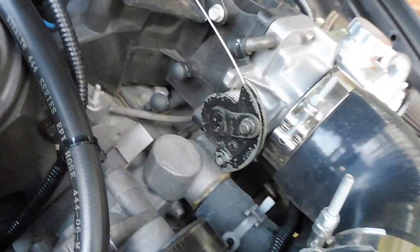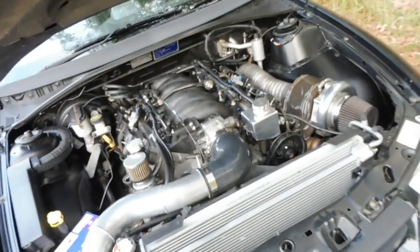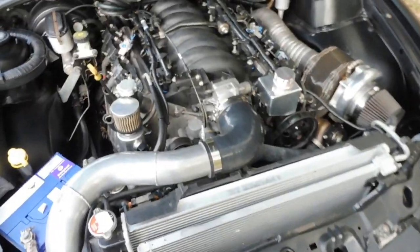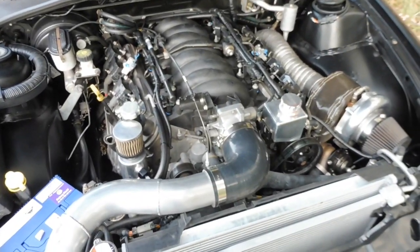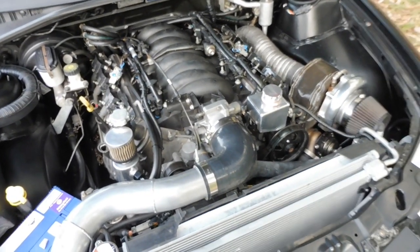On my throttle stop, underneath the throttle stop, there's actually, where is it, under here, there's a little bolt that you get to under the bottom. You can just wind that open and it'll just hold your throttle blade open just that little bit. Sometimes that's more than enough, just to let that little bit more air in there, so it will idle. Now with a cam, there's idle control in the ECU that you can use. You have to have a pretty aggressive cam.